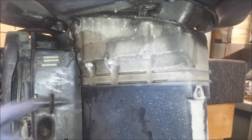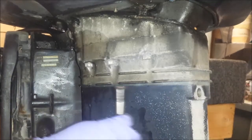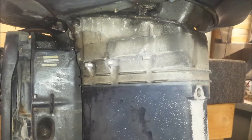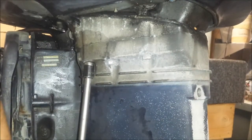Alright, next part. Get the power head bolts off. Three right there. I like using the impacts on those. Hashtag lazy. I believe they're a half inch size. Now, it's a pretty good idea to use a 6-point socket here, not a 12-point, which is incredibly common. All right, got a half-inch bolt, my extension, and the impact.